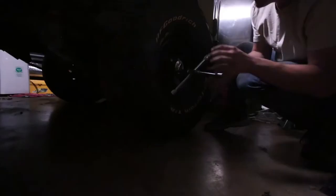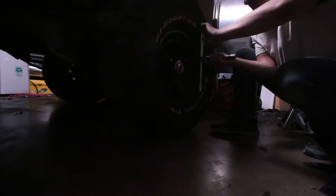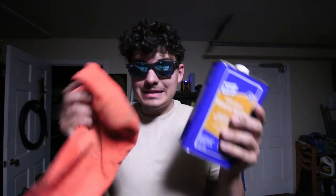I bought this to put around the fender well. First off, scrub. Secondly, sand. Third off, clean. And then last but not least, spray in the stinking undercoating.